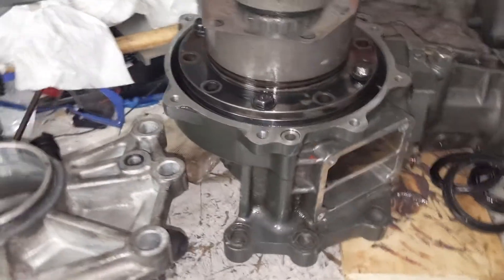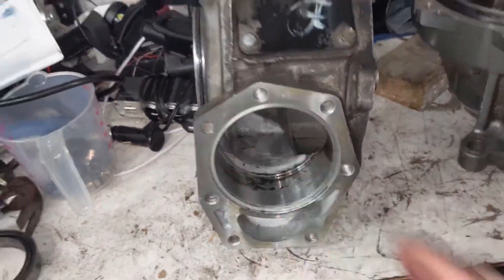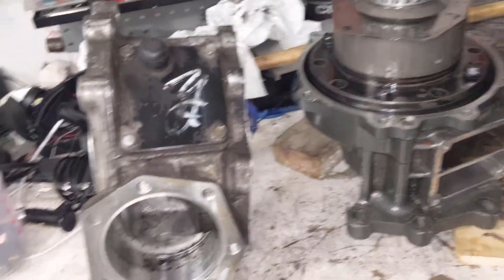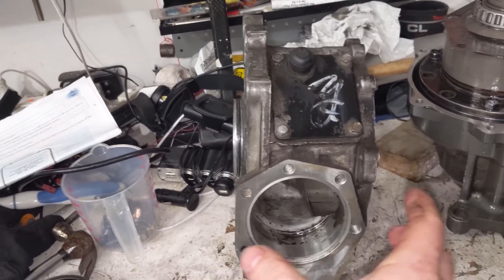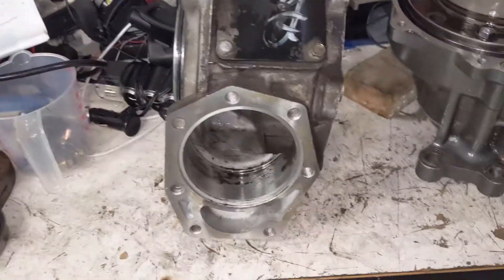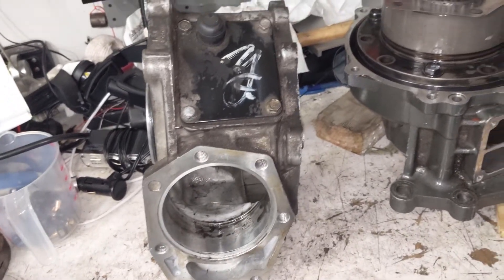The transfer case requires — looking at it vertically — I'll just move my spare one out of the way. So this would be the transfer case looking from the rear, your pinion going that way. Here is your gearbox side, here is your outer casing. You have to shim the diff assembly with its needle roller bearings exactly left and right in the case to correctly mesh the teeth on the ring gear with the teeth on the pinion.